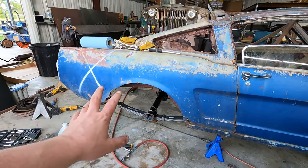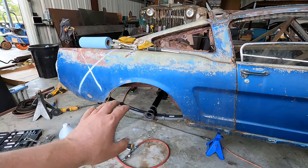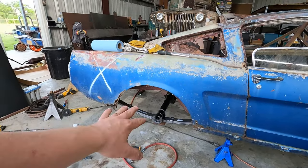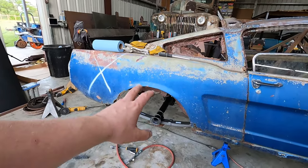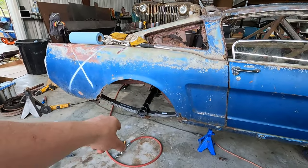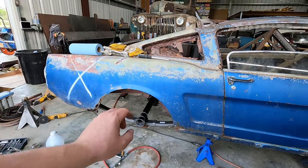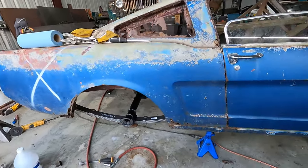So I'm not gonna worry about putting the seals and stuff in now, because I don't want to put them in until the final time so I don't mess them up pulling in and out and stuff. So I'm just gonna stick the third member in, throw the axle back in it, throw some wheels and tires on the back, because I'm also very smart and only ordered one rear shock. So that shock's gotta show up now.